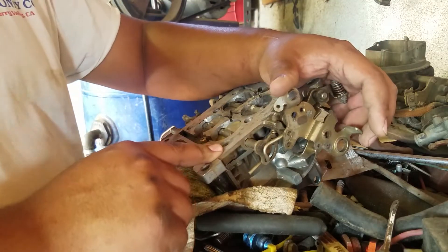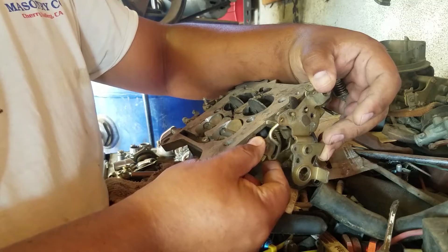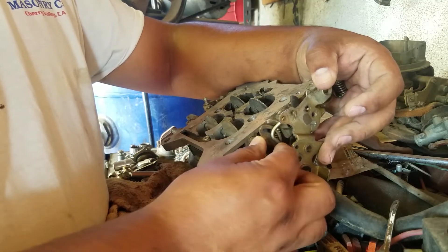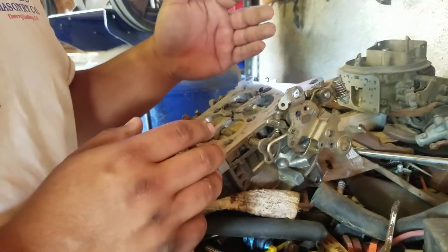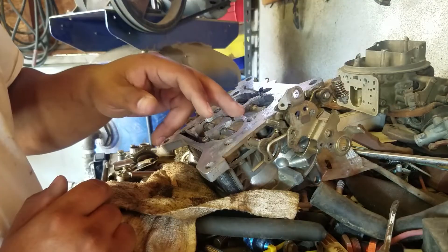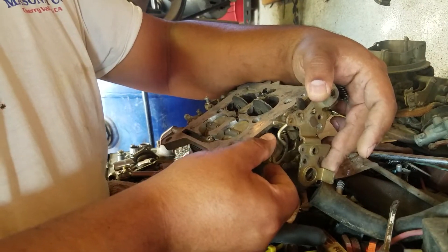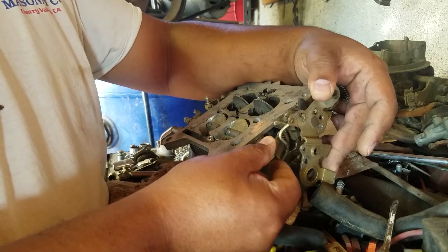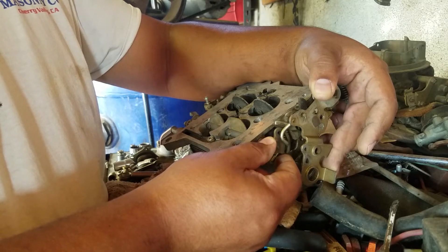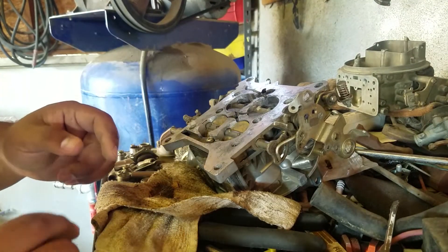You've actually reached your maximum airflow right here — the throttle blades are only going to open to this far. If you take a 428 or 289 and put a 750 on there, when you floor it you're more than likely going to run out of vacuum very quickly and your secondaries are only going to open slightly. If you put a small carburetor on a big engine your secondaries are going to open up almost all the time as soon as you get on it. That's a big reason why you can install a big carburetor like a 750 on a 289 or 302 — you're mainly running on the primary. Half of a 750 is 375, so most of your driving is at 375 CFM. Once you floor it and vacuum starts pulling against the diaphragm, now you have 400, 425, 450, 500 — and then we've already reached the maximum limit, vacuum is gone, it closes, vacuum comes back, it opens again. The carburetor is doing this the whole time on the secondaries, which is a big reason why racers don't like vacuum secondary carburetors — they're a little more unpredictable.